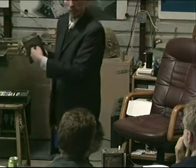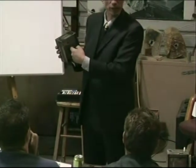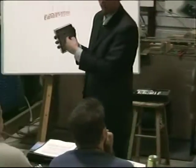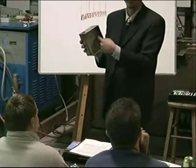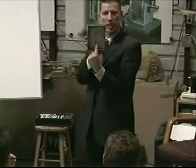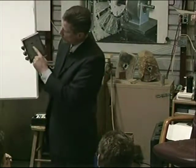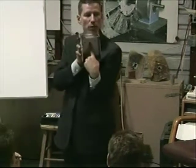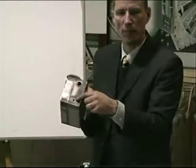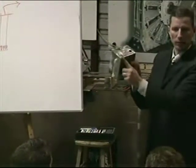This plate is your, all right, who took notes? Cathode or anode. The whole housing's grounded, so. Which one got the minus sign? Cathode. The cathode? Okay. So this is your cathode plate here. And then your water's gonna seek its own level through this little hole. And as the unit produces the water gas, it's gonna pass between the plates through this hole, where it will go back into the water side and come out the top through this port. Right here.